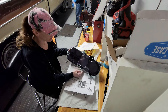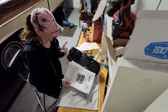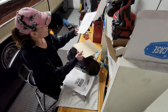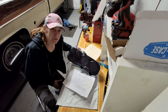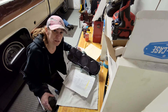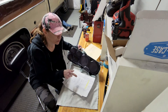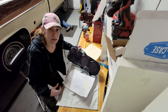We finally got it back together. Make sure you read the instructions — it's very important to set your dip switches for your fuel gauge. Make sure you write down your wiring, which pins you ran what wire to, especially if you didn't have the exact wire colors. When I see you next time, we will be swapping out the connector inside the truck from the stock gauges — we're going to chop that off and put on our end to match up to the new gauges. The blinkers and everything are integrated into them, so we're going to utilize almost all the wires in here except for maybe three. We'll go over that when we wire it in the truck. I hope you learned something and had fun — see you next time.